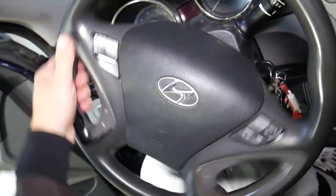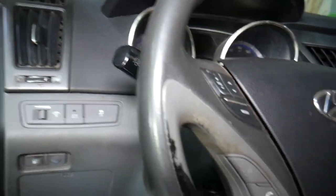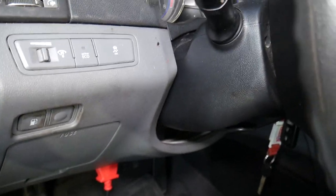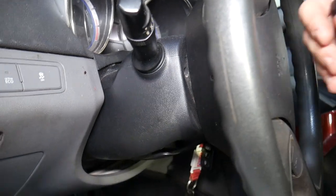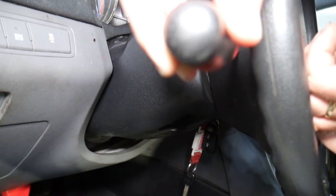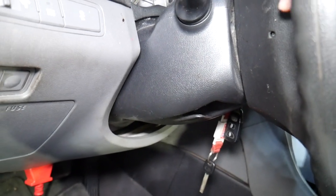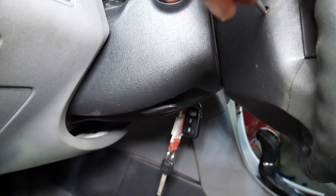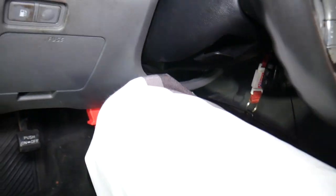It's been an hour, so we're going to show you how to do this. This is the steering wheel airbag — if you have one of these, it's not too complicated. First, turn the steering wheel to one side. You need someone holding the airbag so it doesn't fall off. There's a small hole where you insert a Phillips screwdriver and push in, while one person pulls out at the same time on this side.